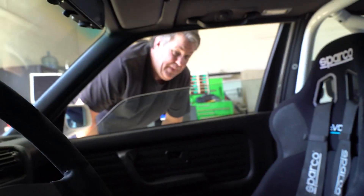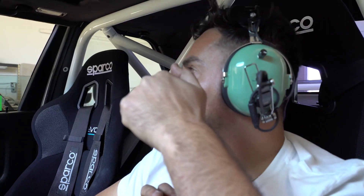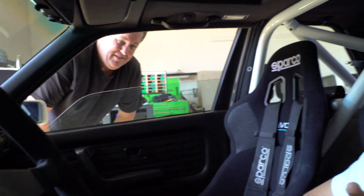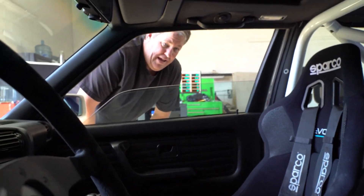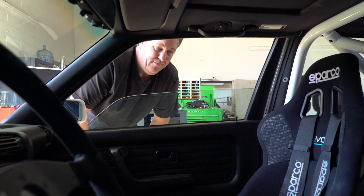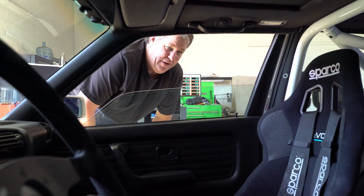Let's pull the spark plug out, take a look, put a brand new one in, do a pull, and see how it's burning - check for any signs of detonation. On K-Pro it has a secondary switch, so you can set a switch for race gas. My thought is to run race gas for safety. On the street, don't rev past 7,500 to 8,000 RPM, and know that to go higher you need race gas at the track.